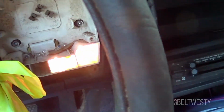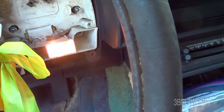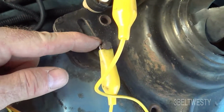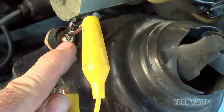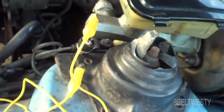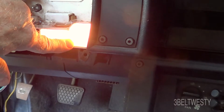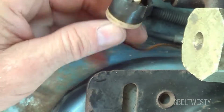So I've got some chocks on this car. I'm going to put this down, then I'm going to go ahead and jumper the wire up front, and we'll see how that works. I've got a pair of alligator clips. I moved this back and forth a bunch of times to get a good contact, and I had to kind of crush the clip, and it's going down there touching this contact. So when this is grounded out, the light should be on. And lo and behold, there's the brake light on. So the circuit to the front works. Grounding this terminal here turns the light on.